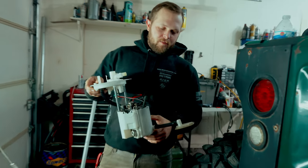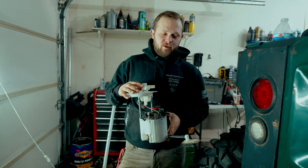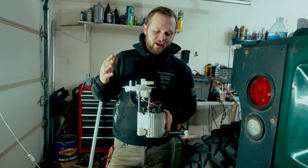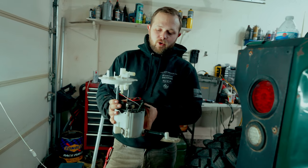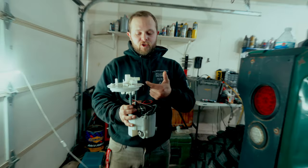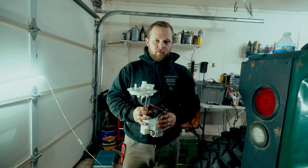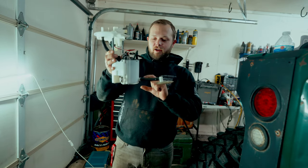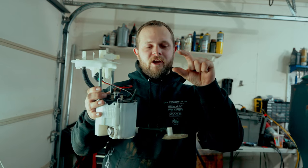These are from a Camaro or a Corvette. They had already had E85 run through them for, I think he said, about 1,000 miles, but they're basically new. So what we did is we dropped it in, and our cap actually fit over this. We just had to trim this tab off, do a little bit of trimming around here, and then just dropped right in. That was great, except for this pickup literally stuck that far off the bottom of the tank.